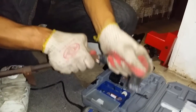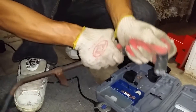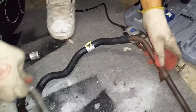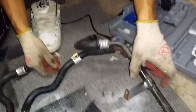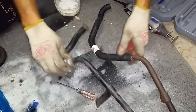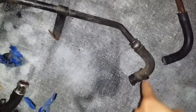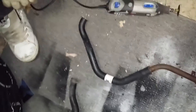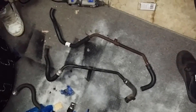So if you have a Chevy S10 with a 2.2 and your heater hose is damaged and you can't find one, this will be the alternative. You can see it side by side — this is one of the old ones that was torn up and punctured, and that's the one that Jason just fabbed. All you need is hose clamps and you're good. That's how to do it.